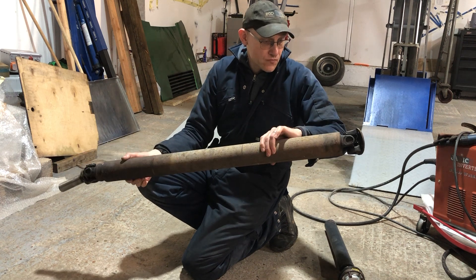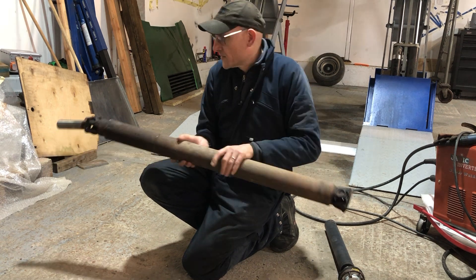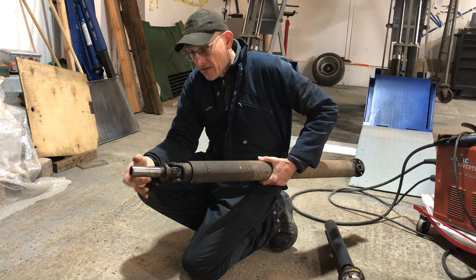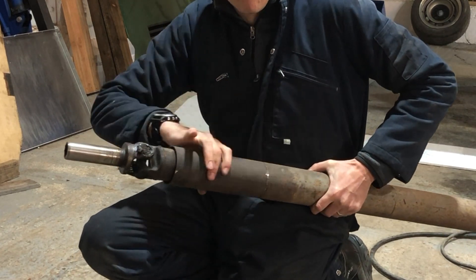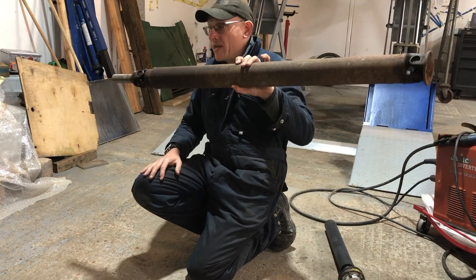I'm really happy with this. So normally we use CAD — this time we didn't, and to be fair it's worked out really well. So here's the original prop shaft off the Lotus. There's a universal joint at this end that goes onto the differential, and at this end it's got a spline shaft that goes into the rear of the gearbox with another universal joint. This spline acts as the sliding joint. It's also got an inner and an outer shaft which are coupled by rubber to give the prop shaft a little bit of compliance. So that's the original one, and we need to replicate that.